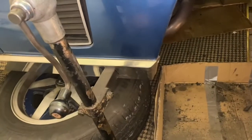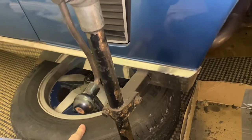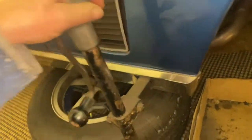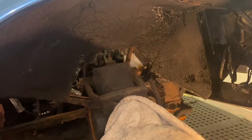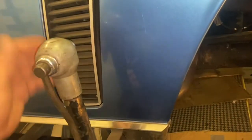Just out of interest — I always put the wheel that I've taken off under the car just in case it all goes wrong. It's not just sitting on that; that's there as another precaution. It's actually sitting on a trolley jack and an axle stand. When I first put it up in the air I use a combination of the trolley jack and the side jack until I can put the axle stand under safely, so at least I've got two forms of support plus the wheel underneath should it drop.